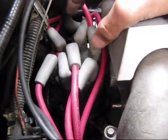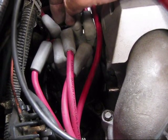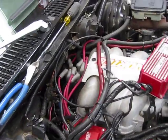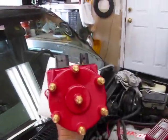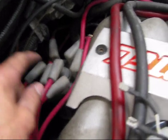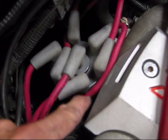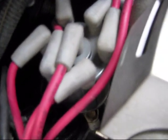What you want to do first is try to make your timing the same when you put the new one in. So try to pick a reference point that you can actually see. The reference point I chose is that the back half of the distributor is flat. Mine's sitting in there right now with the back end turned towards the firewall, so these three points go in a straight line towards that vacuum line, and I should be able to roughly set my timing where it was.